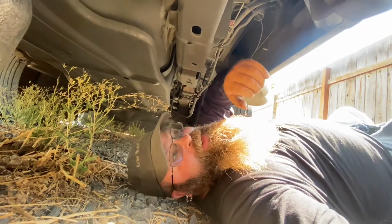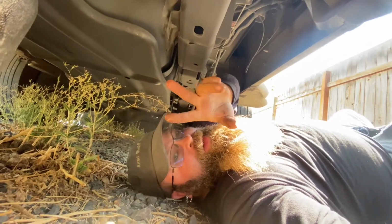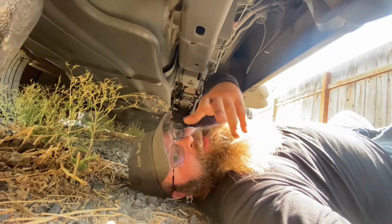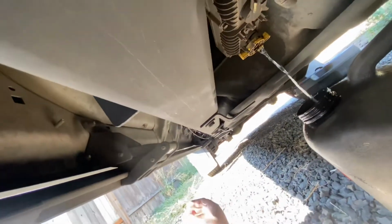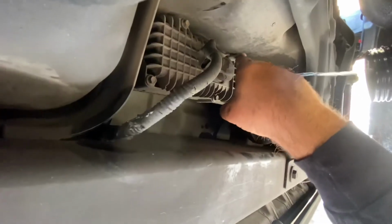Okay, sweet. So today we're doing fuel filters, because there are two of them, an air filter, and an oil change on a 2019 Super Duty. Anything with the 6.7 diesel is going to be the same. Mine happens to be an F450. You get a little jug down here to catch the diesel, and you crack that open. Bam. Then after that drains, 8mm socket. There are 1, 2, 3, 4, 5 bolts. That gets that part of the filter down, and the rest of it is up under the hood.